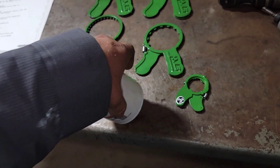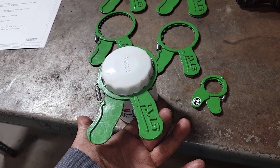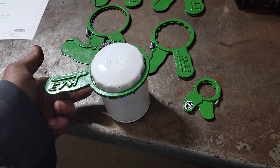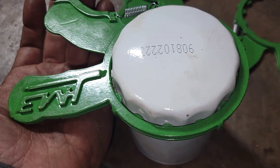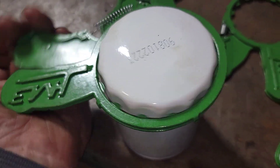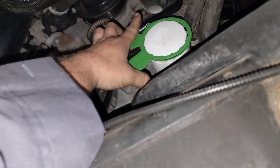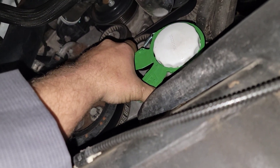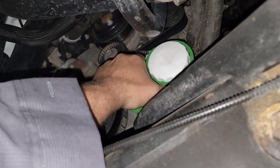This filter fits this particular application. Now lock in the JM3 and move the handle side toward it — your fingers have a tendency to move so you go here and pull, it rotates the filter. Let's demonstrate: pull, it rotates the filter. Getting in here to take this filter off inside the truck it works really well in tight spots. I've got the JM3 on the bottom — lock it in and pull the top down. You could actually lock them both in and just go like that.